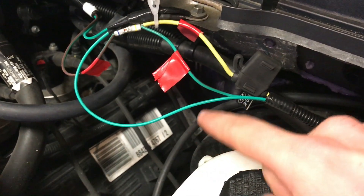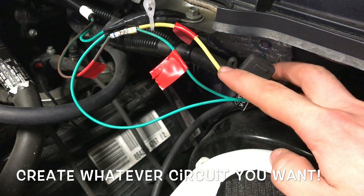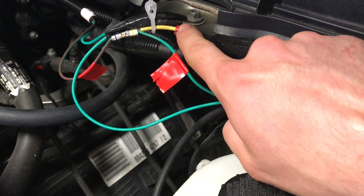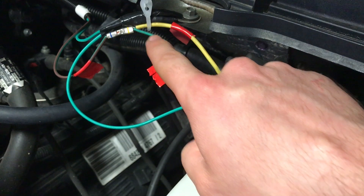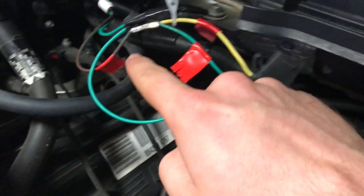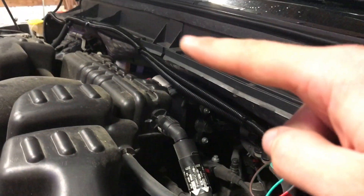I used red tape to show which wires have 12 volts going to them. This is the violet wire tapped in, and it goes through our fuse here, so anything connected to it is going to have 12 volts. We crimped it into a butt connector — this leg goes to the driver's side puddle lamp, and the other goes all the way over to the passenger side.